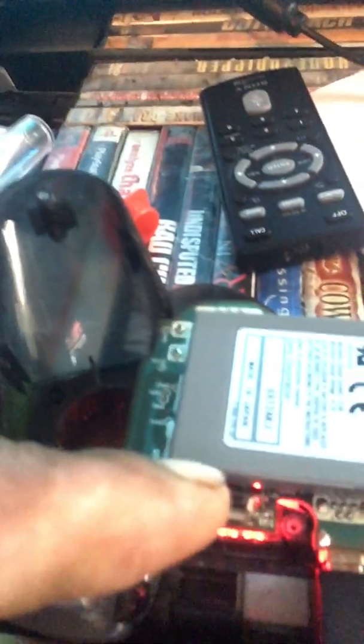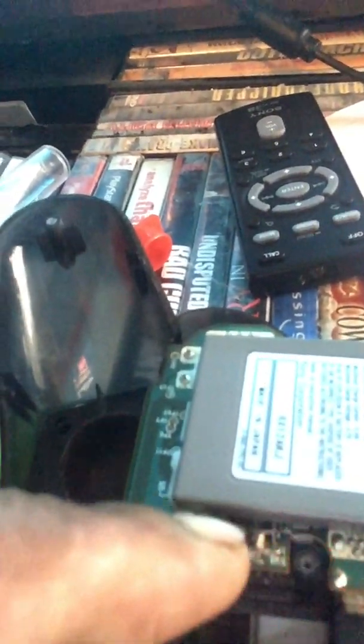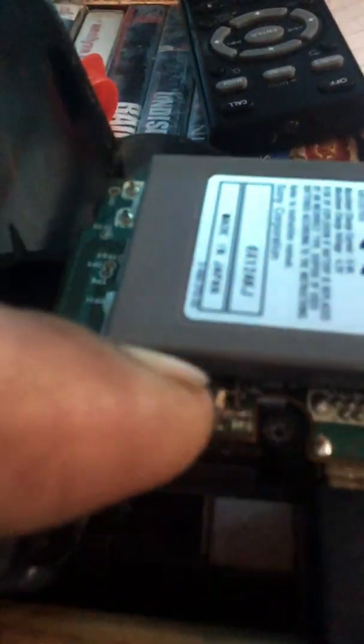After you know the circuit board is dry, then you want to go in and start putting in work. Okay? So the main thing you want to do is make sure you got those flashing lights. What happened for mine, this little component on my reset switch fell off. So what I had to do was reinstall this. This thing right here, I had to put this back in there. And I had to use my solder gun. So I don't know if you can see, that's fresh solder.